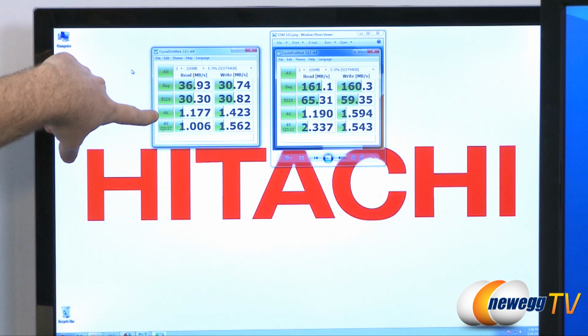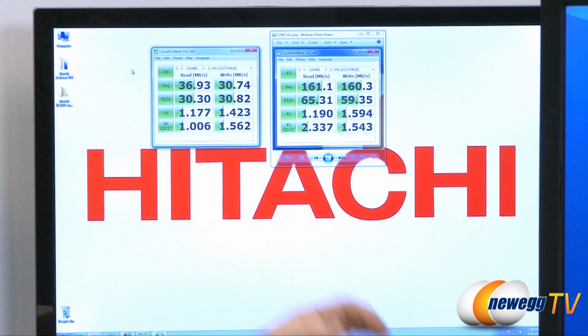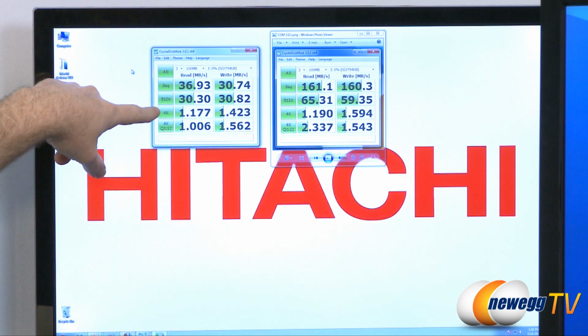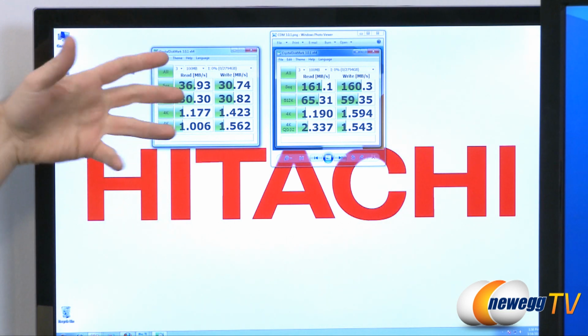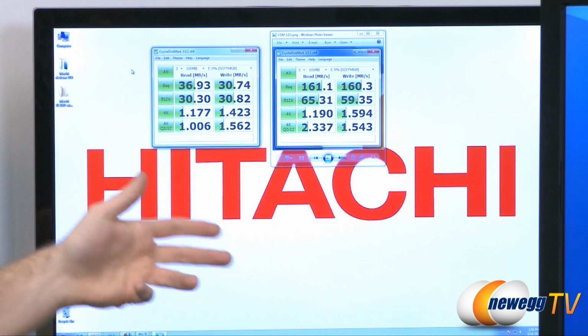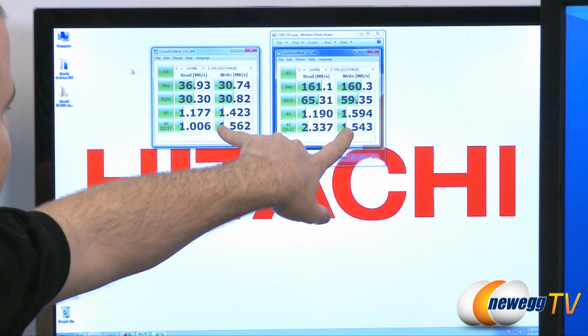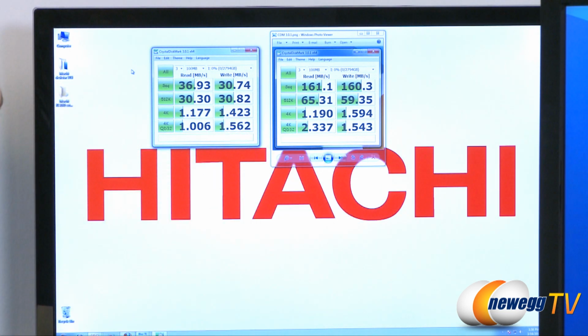If you jump down here to our 4K reads and writes, these are random, so it's actually telling the drive to access random places on the platter to pull out 4K chunks of data. And that's really indicative of the type of computer use that people generally have when you're loading programs or doing applications. 4K is a really good indicator of that. And there you can see really not much of a change.